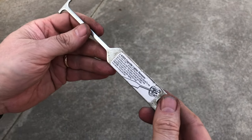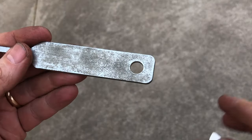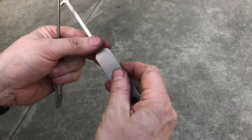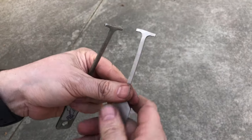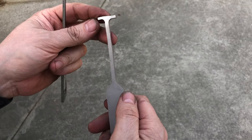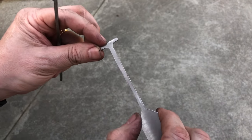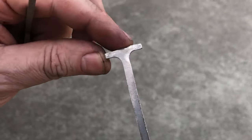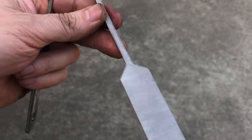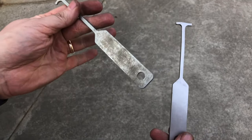The tool I used is the GM tool — it's a J42059 cigarette lighter remover. The genuine tool is made of steel so it's magnetic, but the tool you can pick up at your local parts store looks very similar. The only difference is it's made of aluminum, so it's not magnetic. The problem with the aluminum version is it'll last you maybe three or four uses before, as you do that pull-remove-pull maneuver, you start to get metal fatigue. This one here is starting to get bent and is about ready for the scrap box. But for your own DIY use to pull one of these for one repair or maybe two or three, it works out great. I'll give you a link in the description for both the professional tool and the DIY tool.